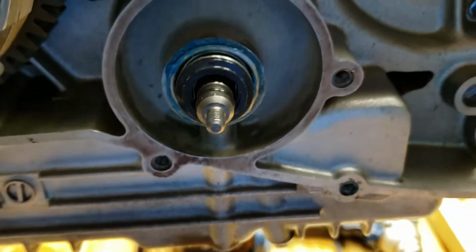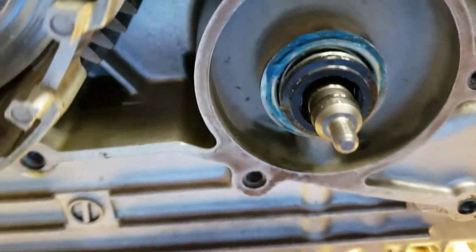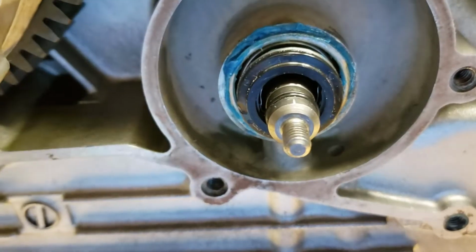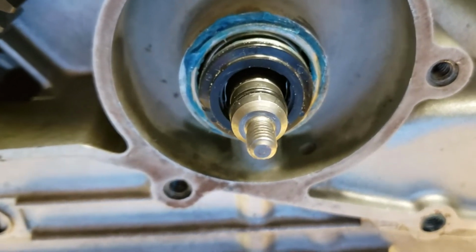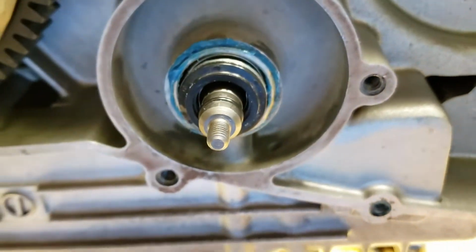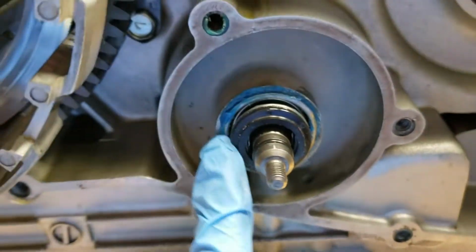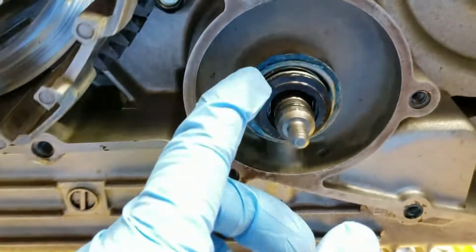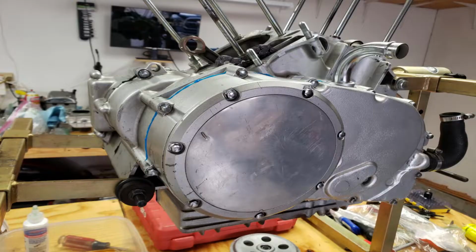On another note, the water pump. The manual says do not use RTV. It had that sealant on the mechanical seal around it, and I went ahead and put some RTV blue on there, good for sealing water pumps and such, because I was a little nervous about the damage that had taken a toll on the ridge and the inside rim of this housing. I didn't want to take any chances. So I did that and put the case on.